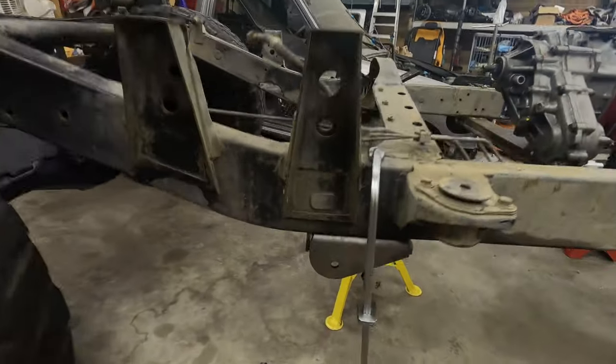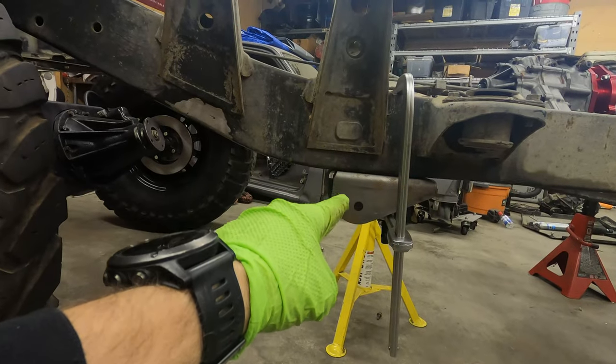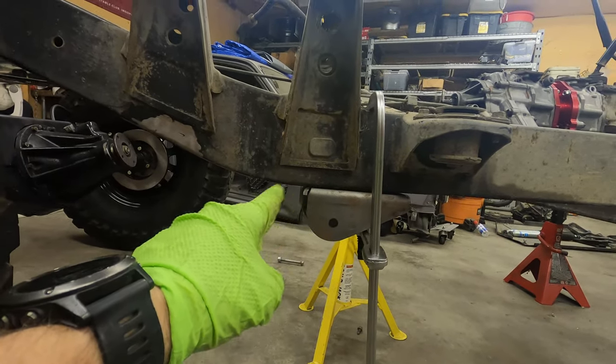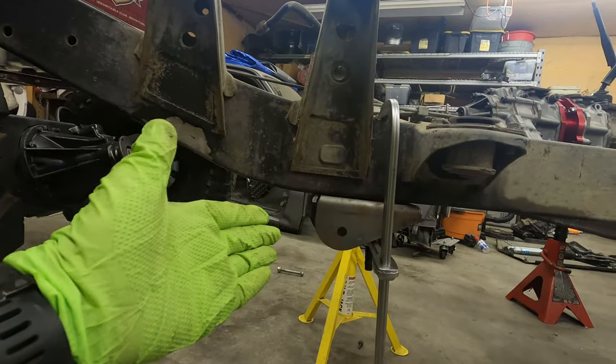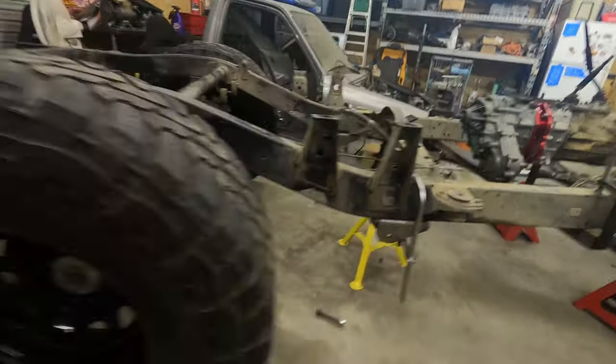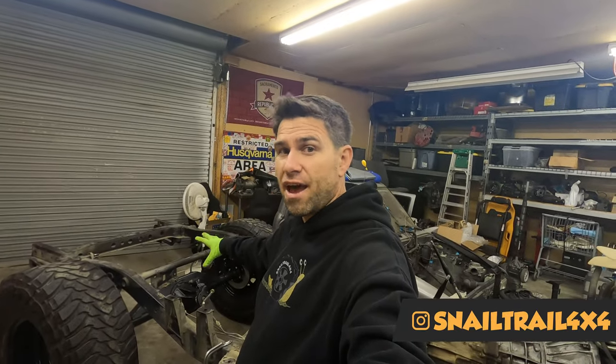So here on the rear, I have just some French spring hangers from RuffStuff that are just sitting on the frame, could be Frenched in or not. We'll just see how that lays out. I just stuffed them up there because I have so much adjustability back here. This is a massive learning opportunity for me. I haven't done anything with those sliders ever. I have thrown leaf springs and shackles underneath the rig, but I'm not quite sure how that will flex.